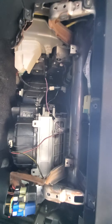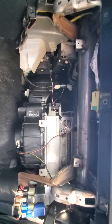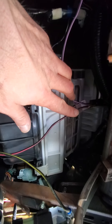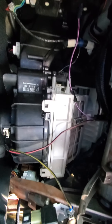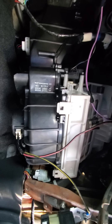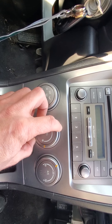Pretty cheap about this one, so let's fix it. Glove box is out — pretty easy, just the screws; there's a few in the top and two in the bottom. If you're not missing all of them like mine — I only had four in here. But as you can see, to make this work they cut the wire, the black-yellow wire, and just grounded it out. We have heat from the blower, but because it's wired direct like that we have no fan speed selection.